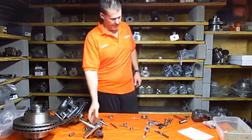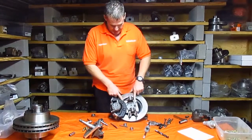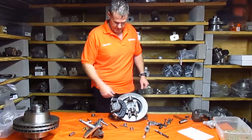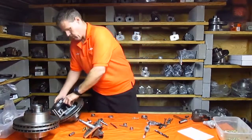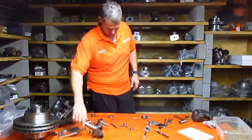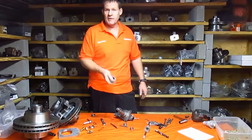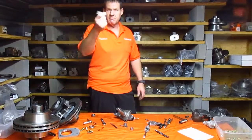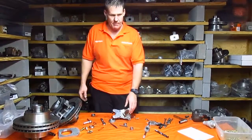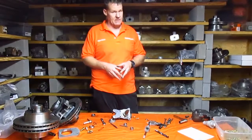Now we're ready. All we have to do is slap it together. Here's an example: here's our plate, here's our steering studs, here's our original caliper bracket, and here's the original caliper. Voila. All the factory bearings — everything stays the same. Slide on the new bearing spacer. You don't even have to put on new bearings if you don't want to — just take the old ones out of your drums and slide them on. It's literally that simple. Fairly easy to do for the do-it-yourselfer, as you can see. It's not really involved.